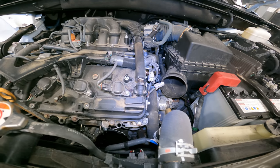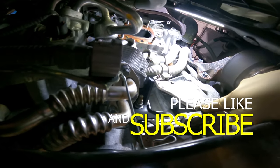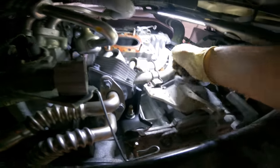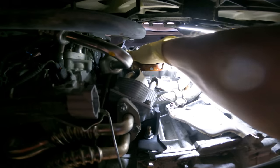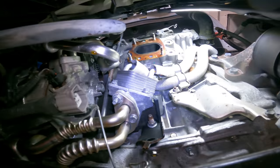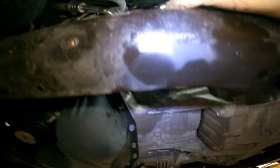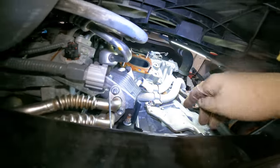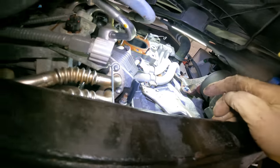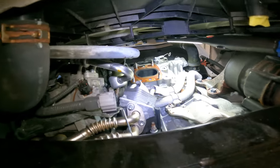I kind of know why they said that. Now that we've taken it up top, our crank sensor is behind here, then the harness goes along here behind these coolant lines, and the connector is up there. We're missing a very important piece right here — we're missing an entire exhaust manifold and cat assembly and Y-pipe, because it's on the ground right there. We had to take all this stuff out of here just to gain access to the sensor, and that sensor is just freaking long.